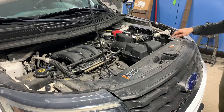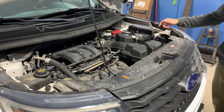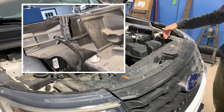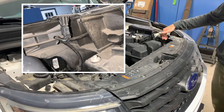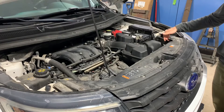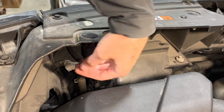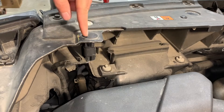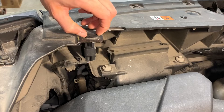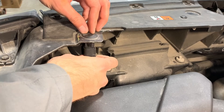We need to add a switch right here. I already have a harness here ready for the switch. If you do not have a harness, you can add one — there are harnesses that you can buy from Ford, and I will try to leave links to that resource in the description below. The harness is attached to the bottom of this plug, and this plug is just a placeholder in case you needed to install a switch later, just like we're doing now.